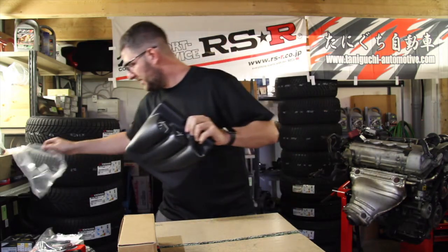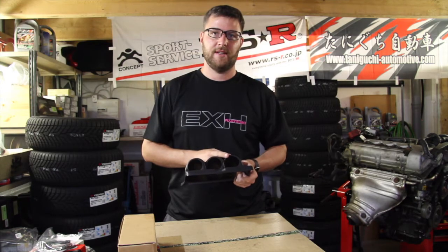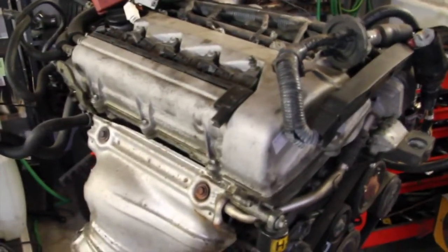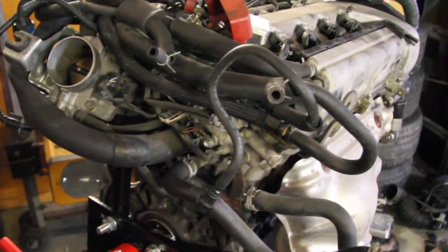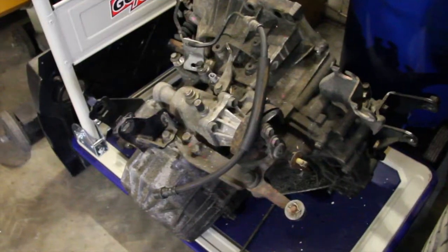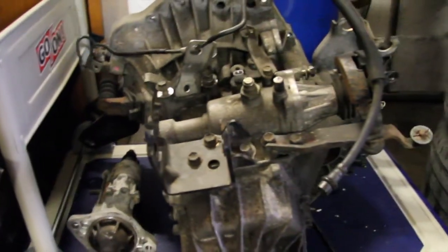They've developed a little kit that allows you to have gauges. Typically I'll be using AFR for mapping, oil pressure, and oil temperature — probably that's what I'm going to use. What would you use? Comment below. You will also need the stock 2ZZ engine, the stock intake manifold of the 2ZZ, all the sensors — you can use the 1ZZ knock sensor — the injectors of the 2ZZ. And the 2ZZ alternator is better than the 1ZZ because it can withstand high RPMs easier. I highly recommend getting a six-speed C60 transmission — the five-speed isn't well-adapted to the 2ZZ rev range. Don't forget the clutch, flywheel, and starter motor.